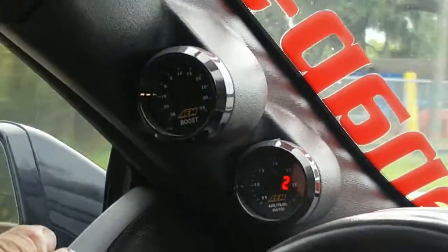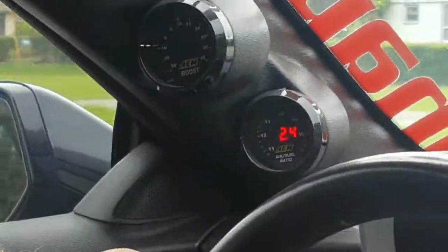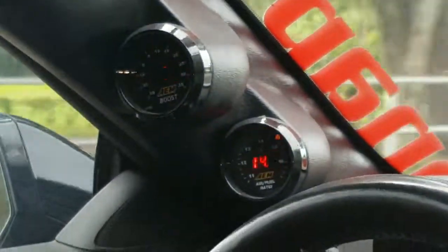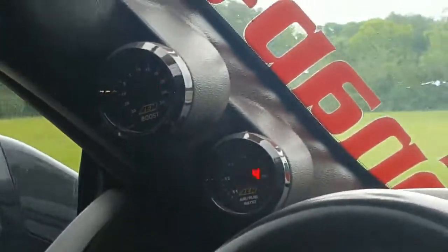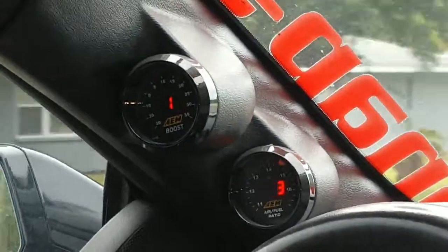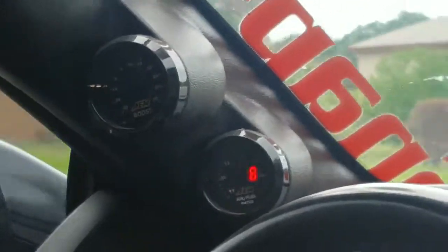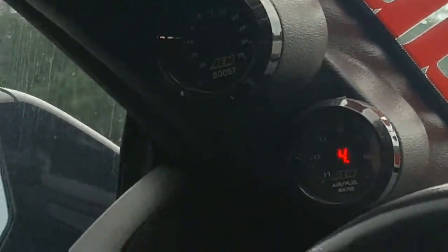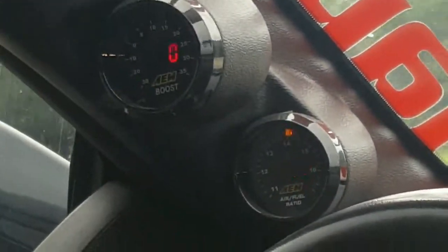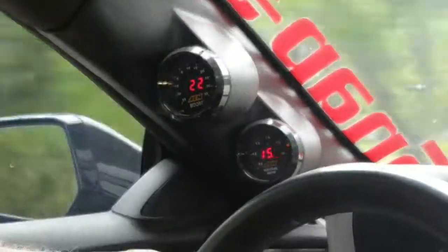This is the time that they are settling and mixing in. We just got to 50 miles an hour — I let off to decelerate and we go to full vacuum. But if I set the cruise control right now, at a 50 mile an hour cruise, we do have enough vacuum to sufficiently evacuate these contaminants. Otherwise, during the periods that there's any acceleration, we drop to zero.